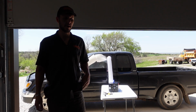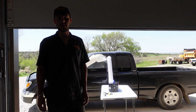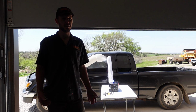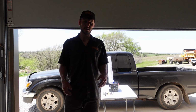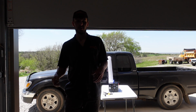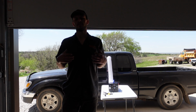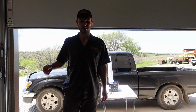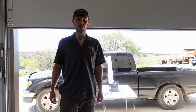And obviously, also don't forget to shut the vehicle off if you have the vents and the air conditioner running. And you really only need to leave it running with the air conditioner for 10 to 15 minutes. Leaving it running for 30 minutes would be really overkill, because all you're really trying to do by leaving those vents open is getting the ozone inside the vents, because that a lot of times is where the odors live. And you obviously can't get into the vents to clean them out with a brush and all that. So you don't have to leave the vehicle running with the AC on the entire time you're generating the ozone.